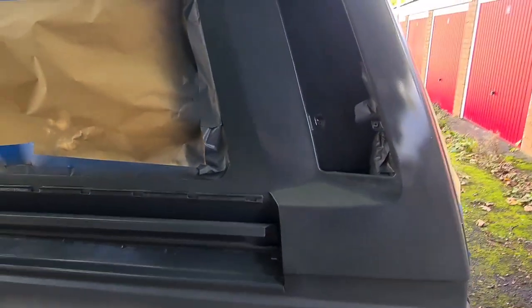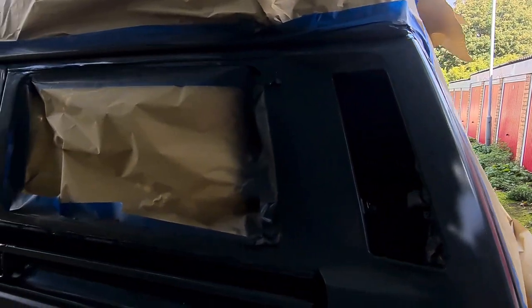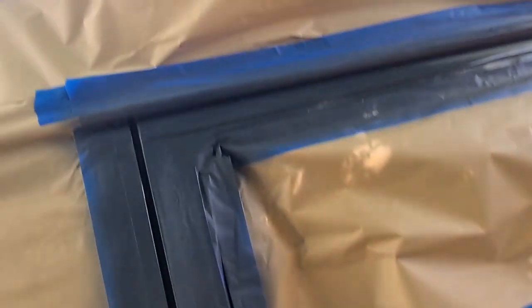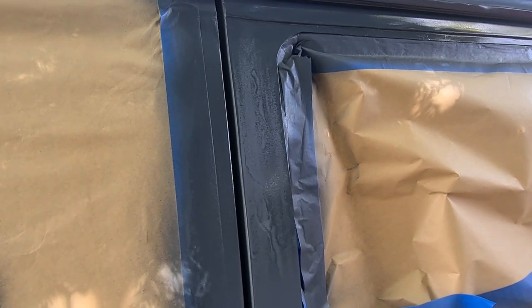It's the beauty of this stuff. If you're not happy with the repair or there's a scratch in it or whatever you want to get out, just get it out before you put another coat on. I'll show you that there. So that's showing up quite bad, the rings in that filler. So I'm going to knock that back just a bit now with a bit of 600, and in some other areas around the top where it's starting to blister up just a touch. And I'll show you when I'm done, just bear with me.